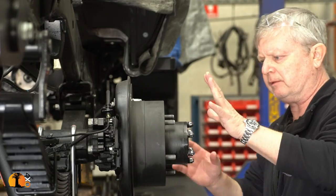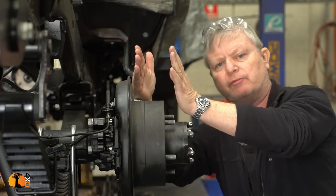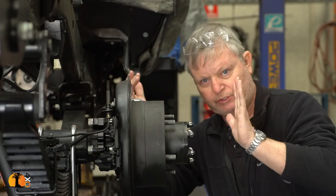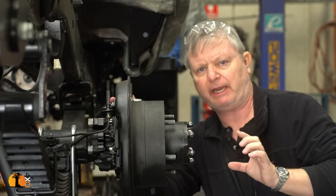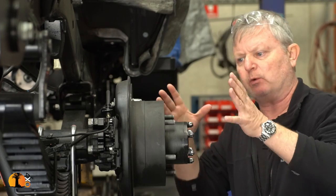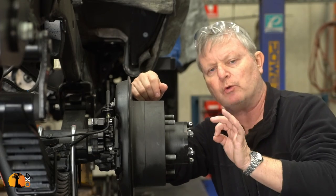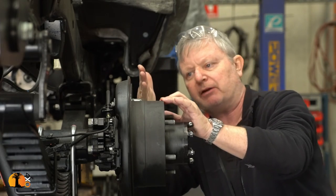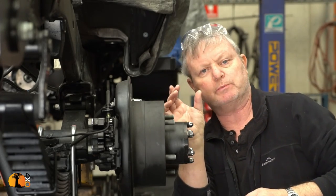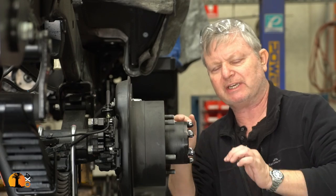The Multidrive TrueTrack has been fitted here. Basically, it has moved the center point where the bearings sit, expanding the overall width of the rear axle by 110 millimeters — 55 each side. The other way of doing it is with a wheel rim that has a different offset. In Australia, an offset of more than 25 millimeters over the bearing is problematic, because the wheel should run over the center of the bearing. The moment it is offset, it causes more wear on one side of the bearing than the other. Anything over 25 millimeters is illegal in Australia.